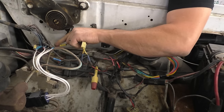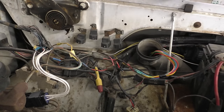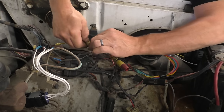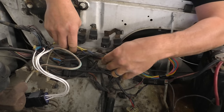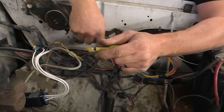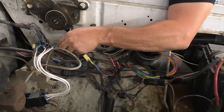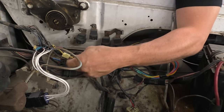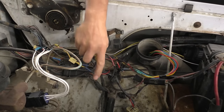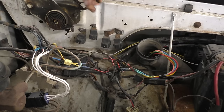I assume this other big red wire must have full-time power on it. Our connection is at this vampire connector, old Scotch lock looking unit. So once we have that, our relay we can put in, the relay will work. But honestly, at the end of the day, this needs to be fused. It kind of is right now with the orange fuse link wire. I think the white fuse link needs to come off and go to the red. So let me figure this out and show you.